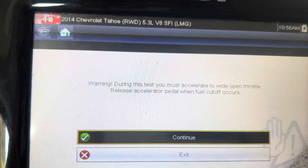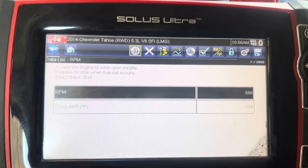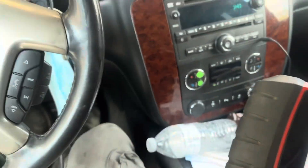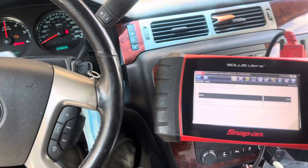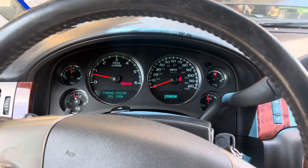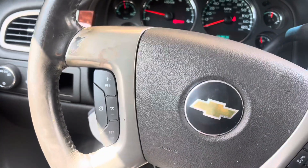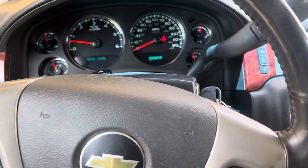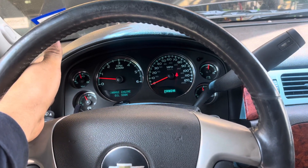Make sure you're at least right there on the coolant temperature. Then you're going to accelerate all the way to the bottom for just one second. Watch it — there you go, test complete! The check engine light will automatically go away. You can take off your parking brake, turn back on your AC, and you're left with no check engine light at all.